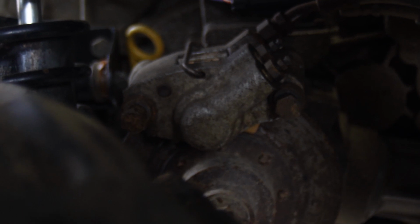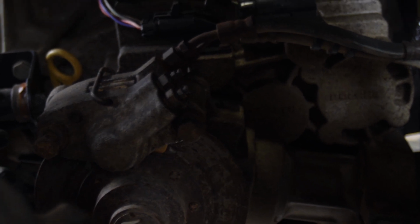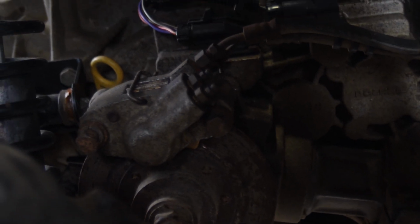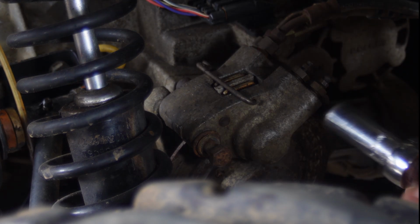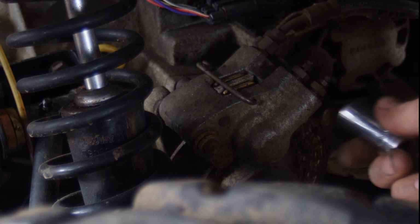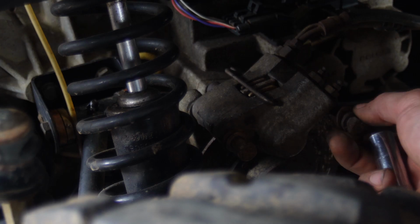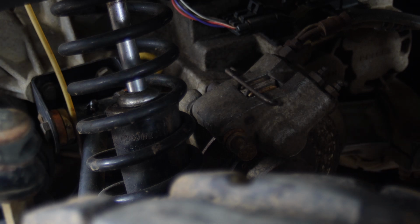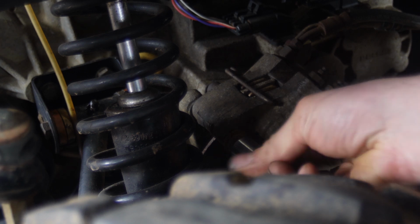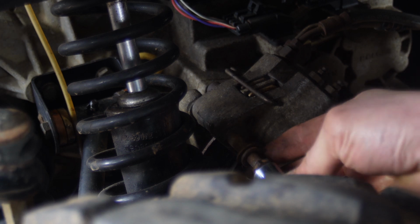Alright, let's have a look right there. We got a brake caliper that sits on a little disc that runs off the gearbox. So let's get that guy off of there. That was barely tight at all. That one too. I hope it's not stripped out. This is a weird little caliper where it's got two pistons in it. One operated from the front brake lever, the other one operated by the foot pedal. That's why there's two lines going to it. So should be interesting.